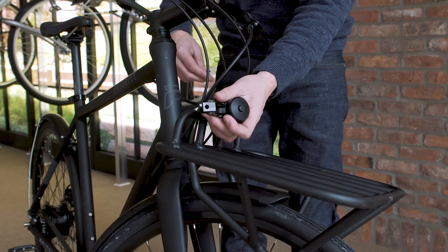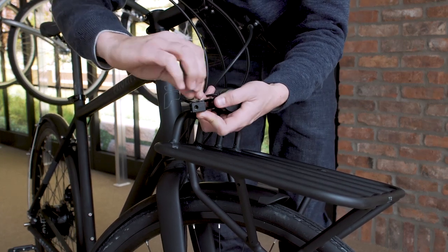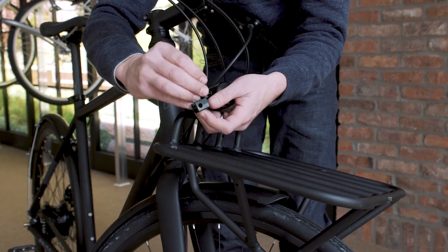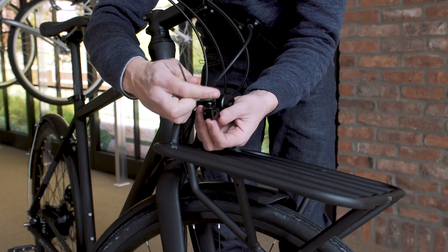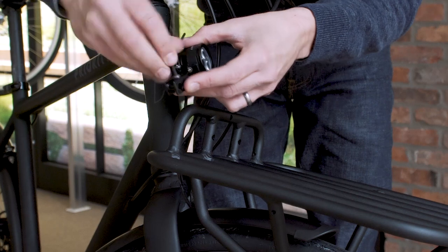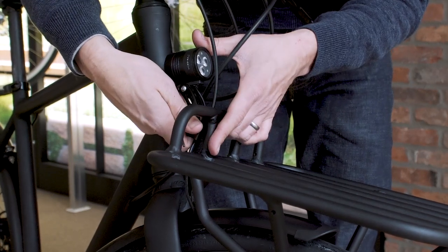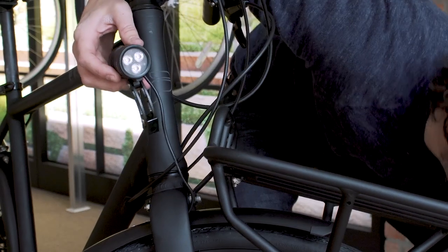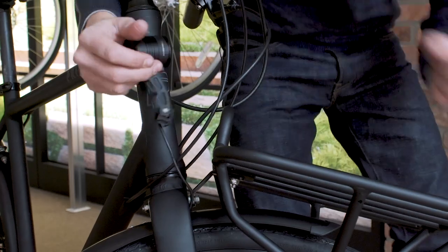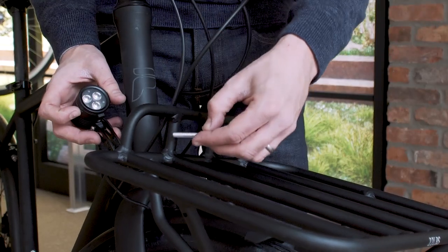Now, if you have a front light, we're going to start by reversing the bottom bracket using a 2.5 millimeter wrench. Once your bracket's flipped around and tight, you'll see the bracket's now in the right spot for your headlight to point forward. Of the bolts you have left, grab the longer bolt. You can start it with a washer. Put it through the right side of the rack.